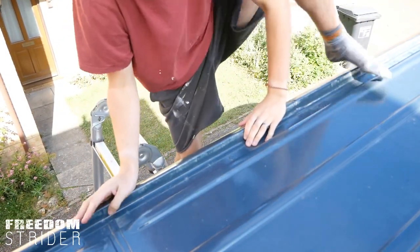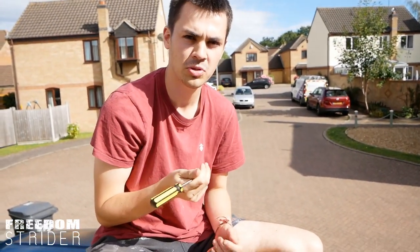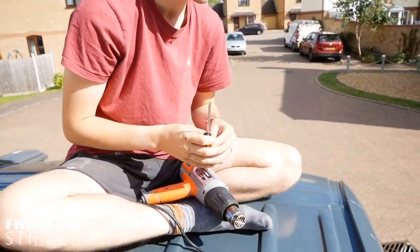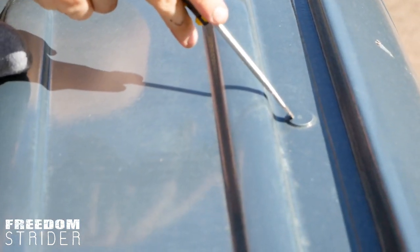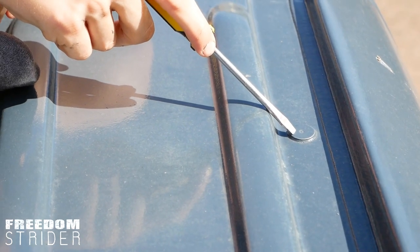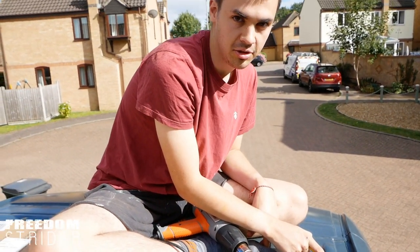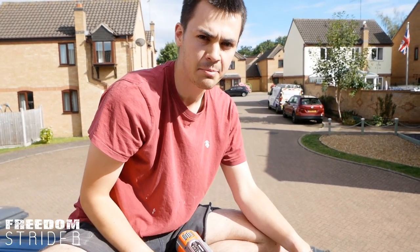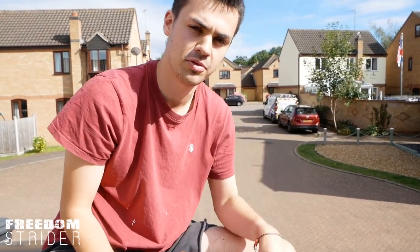We're on the roof and we're going to be preparing the holes that we're going to be using to mount the unistrut to the actual van. Luckily, on our van — and I think pretty much every modern van — they have these pre-drilled holes all down the side channels on both sides. However, from the factory they come sealed so you get no water leaking through. We just need to remove all these caps off all the holes going down both channels, and that will provide our bolt holes to bolt the unistrut in.